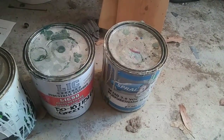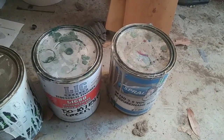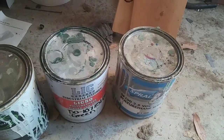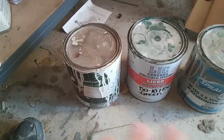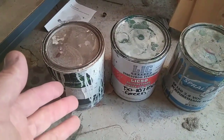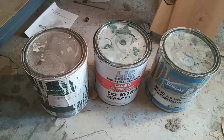Keep that in mind when you're mixing it — it still will break up fine if you have a good spray gun. You might want to do a test panel and try it out first before you go paint a whole car. If you're painting a solid color and not putting metallic in — if you're putting metallic in, I wouldn't even use single-stage urethane, I would go right to a base coat clear coat. If you're doing single-stage urethane as a solid color, this comes out really nice. It'll come out just as shiny as if you used clear coat.